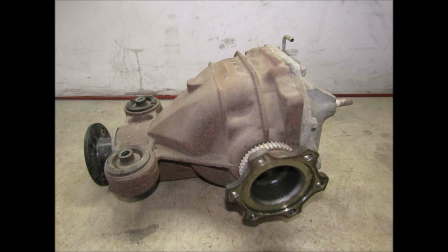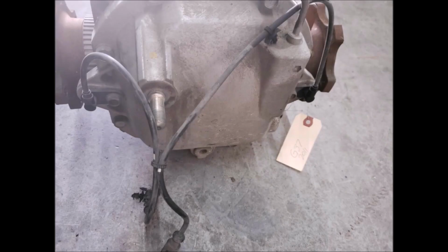If they have it listed as an all-wheel drive and it's locking, it is probably listed improperly on one or the other, and I would probably just avoid it. You will not need any sort of speedometer correction or have any issues with wheel speed, because the way the car learns how fast it's going is the sensors on the stub axles.